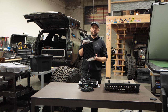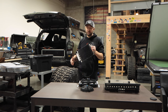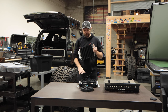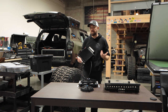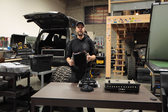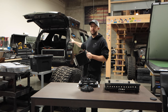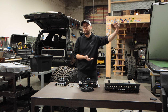A plate-and-fin cooler is the next step up from a tube cooler — it works better because it holds more oil and maximizes flow. Above that is a stacked plate cooler, which gets even more oil flowing. If you can fit one, great. I actually figured out a way to fit one of those on top of everything I have here as a backup. But the bottom line is: get the most you can afford and the biggest size you can fit.